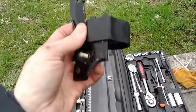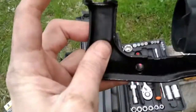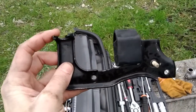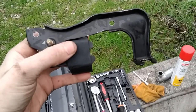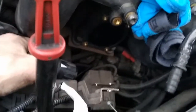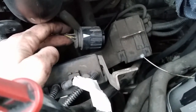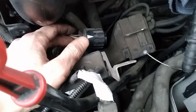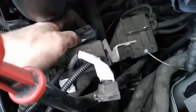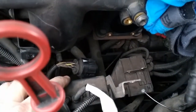I think I fixed it. Just to finish with the ICV valve part, I wanted to show you the support of the valve and see how different it is from the M54 engine. Here in this part is the support for the cable of the throttle valve, which is the big difference regarding the M54 engine. I just pulled out the throttle body from the intake manifold and as you can see the plug that switches inside the throttle body is completely different from the M54 engine.